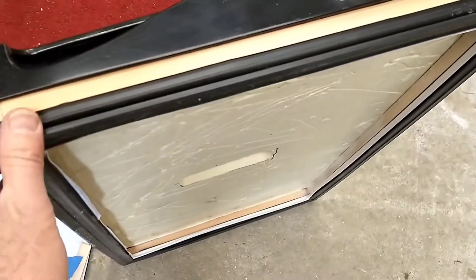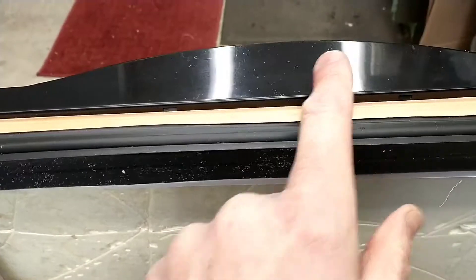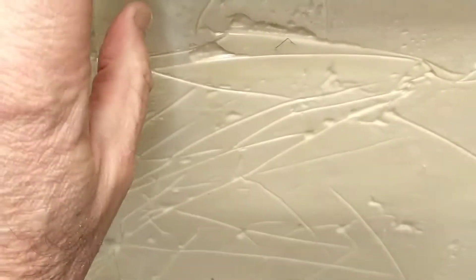The way this works is: originally the door has this whole plastic tray in the front, held on with little sheet metal screws around the edges. Remove all that. Then I took the plastic out of the gasket and cut it away, leaving behind the frame of it. You need the frame to put the gasket back but you don't want the tray — I just cut it with a razor knife. Then I installed the wood with sheetrock screws into the door, and reinstalled the frame back with the original sheet metal screws. So it's back in just the way it was, and it closes great.